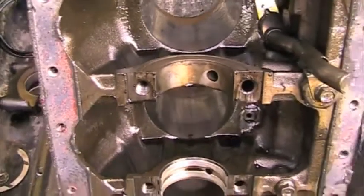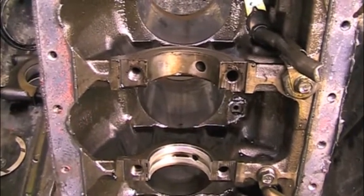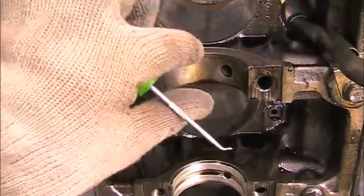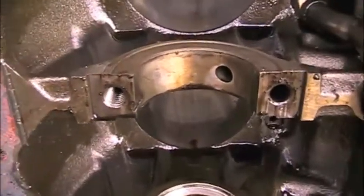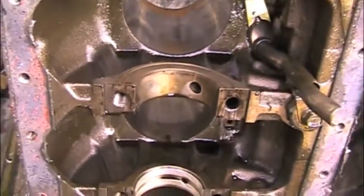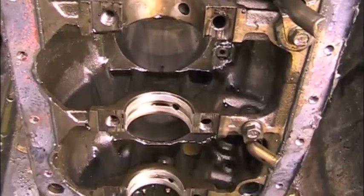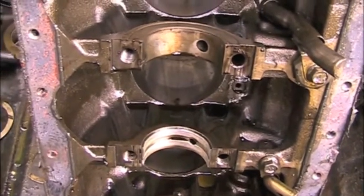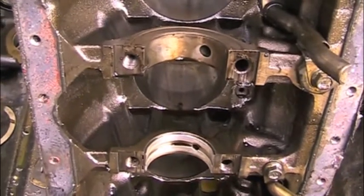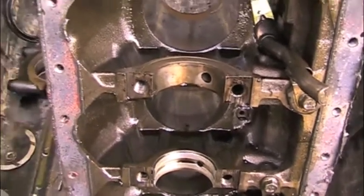If your motor is leaking oil really badly from the front and rear main seal, that is very common when the crankshaft is no longer being located and starts running back and forth — it starts pushing more oil out the front and rear main seal. You might think your motor is leaking oil real bad and you need to put a front seal in it, but it's not going to make any difference if this is the problem. If you've got oil leaking pretty badly and you're hearing a slight rattle coming from inside of the motor when you're decelerating or just as you stop accelerating, you need to plan on a new bottom end before you rebuild that thing.